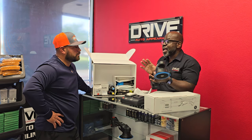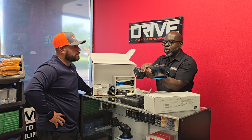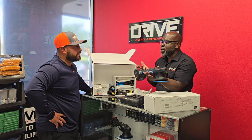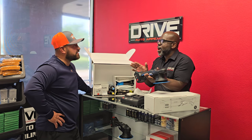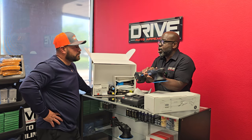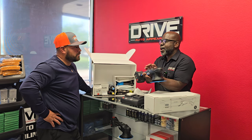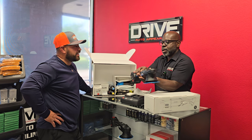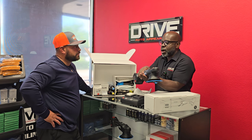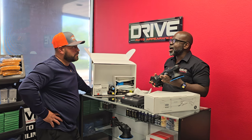Now listen to it spin. That's cutting power right there at one. When you turn up to two, it's even more balanced. That's three, and we're still having a conversation. The normal operating range for speeds for a RUPES is really 3.5 to 4. That's 4 right there. That's 5, and vibration is literally nothing. We get a little vibration at 6, because it's spinning super hard and there's no pad there. But when we have a pad, it will be a lot smoother.